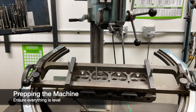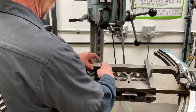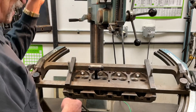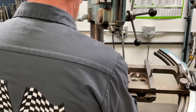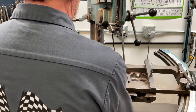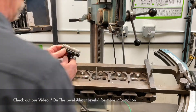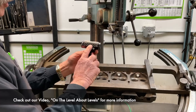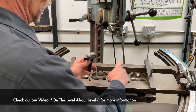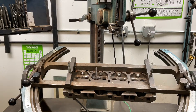I've got my seat and guide machine. I've got to go through a leveling process — good thing I've got my Goodson level right here. I've already gone through it; I've preset this so I'm level left to right. I'm going to double check my level front to back — I've got this all dialed in from before. You've got to calibrate your level. You level the machine to the level and then everything going into the machine uses the same level and then we're all synced up.